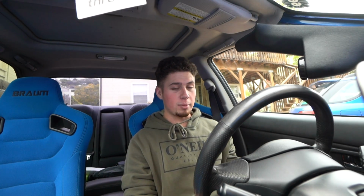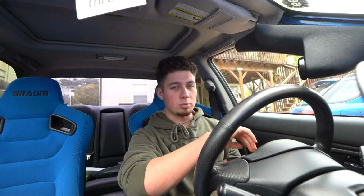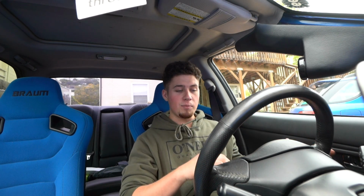So, I got the car up in the air, and now I turned the car on, and I'm moving the steering wheel. And so I got two issues. Number one is there's still air in my system because I'm still feeling a vibration in the steering wheel when I'm turning, like kind of if I was to go faster than normal. Normally I'm supposed to go slow, I was going slow, but it still started to vibrate, so I still got to bleed my power steering, right? But I was just getting over doing that, so I decided to give up for the night, and I was going to put my car down to the ground.